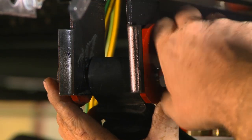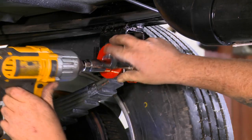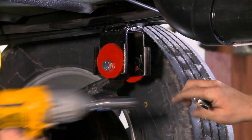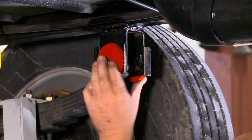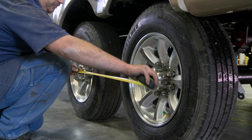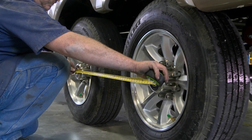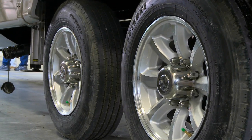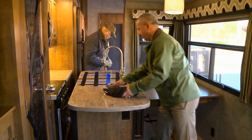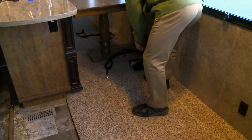We then adjusted the rear axle by adjusting the cams to bring it in line with the front axle. All Bullseye cams were tightened leaving a small gap between the spring and the hanger. The trailer was put back on the ground and ready to travel. You may ask why this can't be aligned at the factory — it can be, but when customers get the trailer and load it, the axles need to be realigned, which would cause double work.